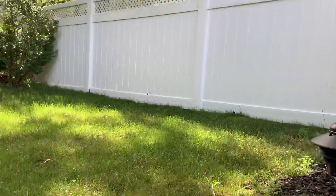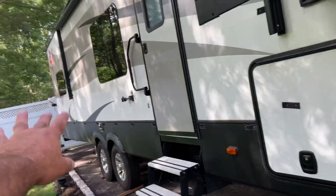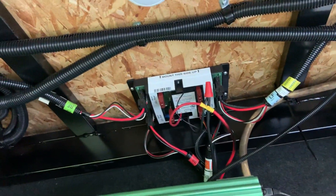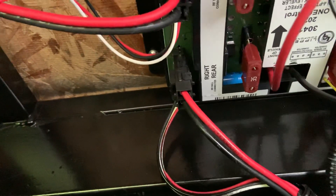That's it right there on the frame, held by that little box with two self-tapping screws. I'm going to replace that — unplug the modular plug and I should be good. But before I even do that, I'm going to plug in the rear sensor just to make sure it works. I don't want to change it and find out it's still not working. The rear one is located about four to five feet behind the rear axle on the frame rail in the center. The front one is located right in your front bin up on the roof. You just have to follow front to back — see how it says front pointing to the front and rear to the rear. Mount that side up.